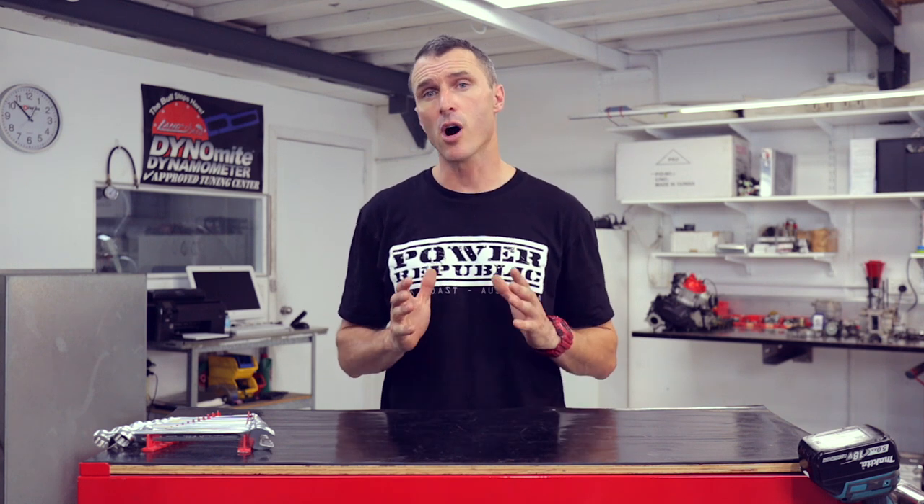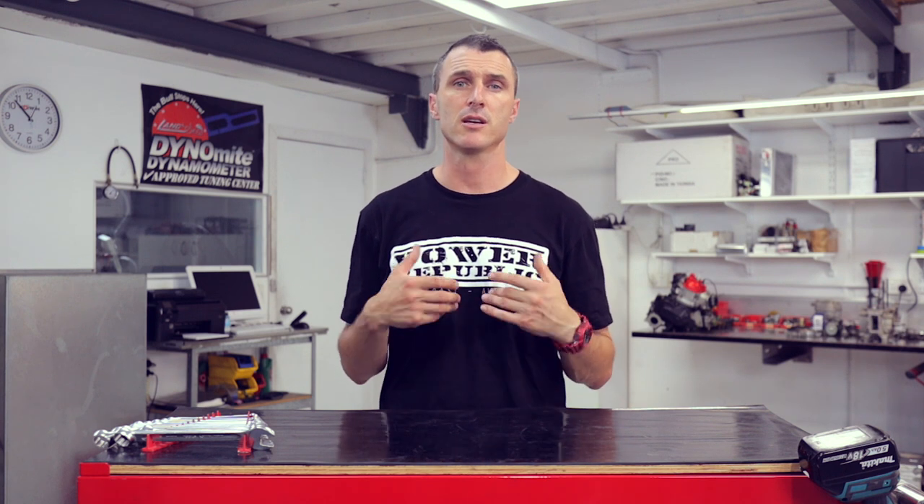Question number four is for our X30 friends: I have just replaced my conrod and piston rings in my X30 — do I need to run it in? This question is very similar to the Rotax question. I would recommend running in your new piston rings in your X30. They do have a tendency to seize, and the X30 has a cast iron bore rather than a nickel bore like the Rotax, so it benefits from running in. If you've also changed your conrod and bearings, it's good to cycle them through a couple of heat cycles and let them cool down so the engine gets time to warm up and cool, allowing oil to condense inside and get into the bearings and seals.